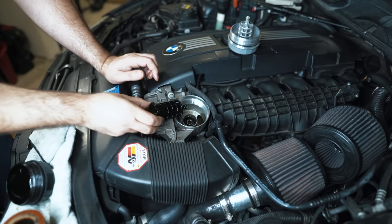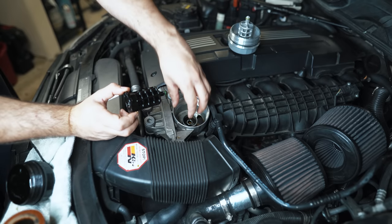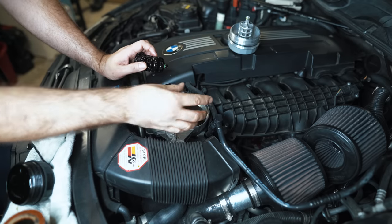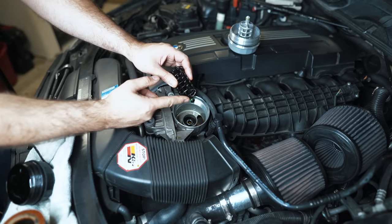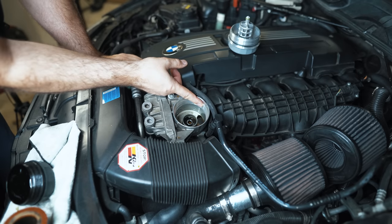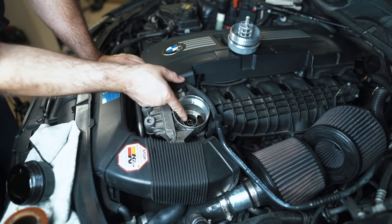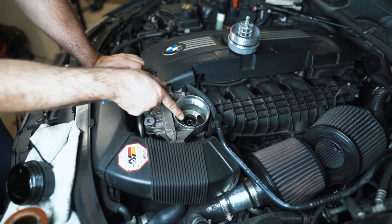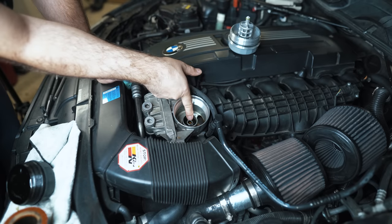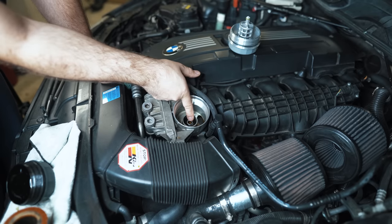So when you're pulling your oil filter cap off, all the fluid that would normally be sitting all the way up here drains out so you can change the majority of your oil. If you didn't have the stopper, it would be full every time you take your filter out and it would drip everywhere — it would be messy. This is for convenience. So dirty oil comes from the outside, through the filter. If there's too much pressure, it goes up through the bypass valve so excess is bled off and you don't collapse your filter or starve the motor. The secondary circle is your drain — it functions as a tiny little drain back to the block when you want to change your oil filter.